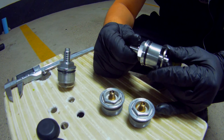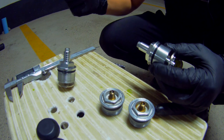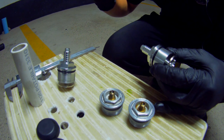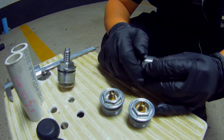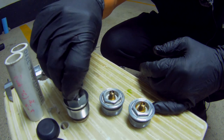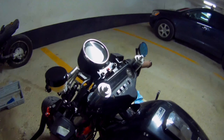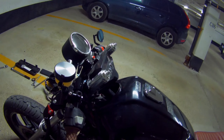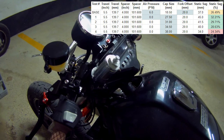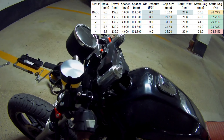But we're going to do it anyway just to make sure that is the case. If those prove to be not so adjustable — because with this much extra at the minimum, I believe it was roughly 16.5 millimeters of adjustment — that's only going to add more preload to the springs, which will reduce the sag. So if we see sag that's already too short at the minimum setting, we'll switch over to the 3-inch 5.8s, or 92.075 millimeters, and hopefully get a lot more adjustability with that. Let's put these on the 4-inch spacers and see what kind of sag we get.